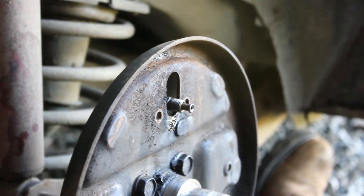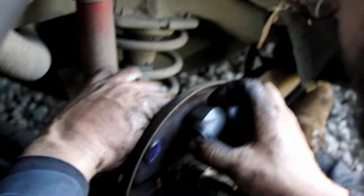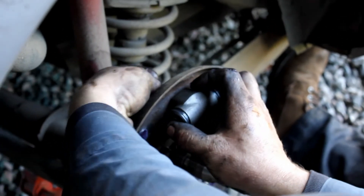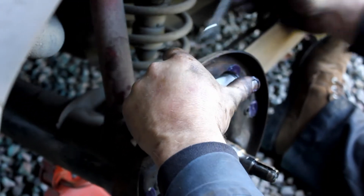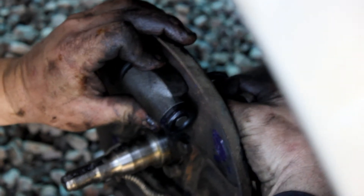Go ahead and wipe everything down, like you're seeing right there. See how the bleeder valve isn't in the new one currently — so you go ahead and stick your new bleeder valve on there and start getting it threaded. Then you're going to attach the brake line. I'd do the bolts first, probably. So he's got the line in there and he's putting the nuts on.